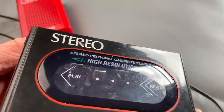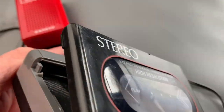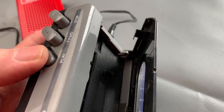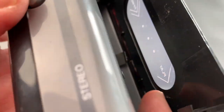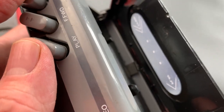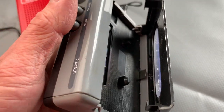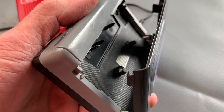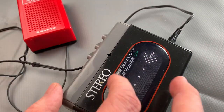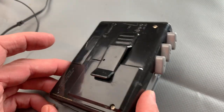I've had a cursory look and I can see the head is pretty clean, so it's not going to cause too many problems putting the tape in. Sure enough, it's working — you can hear it. But obviously the belt is not attached; it's obviously degraded or slipped off or something like that. So we can't go any further anyway, and to be honest it feels quite grimy and sticky and horrible. So we'll do all the work on it now, get it up and running.